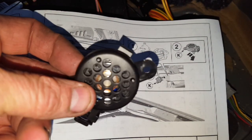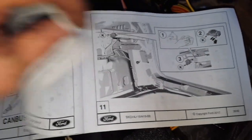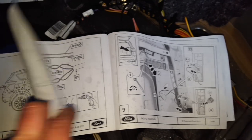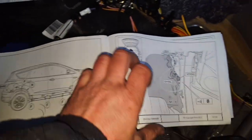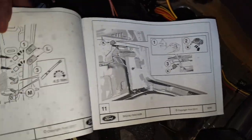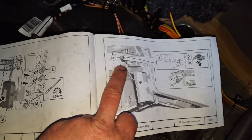Next we've been told to mount this speaker sounder. I have chosen to skip the canbus sections at the moment, mainly because it's raining and I'm currently working in the boot. All we've come up to so far is how to thread the canbus wires and which loom to cut into — we've done that section. We're now going to fit the speaker and come to the canbus wires in a minute when I can get the doors open and it's not pouring down with rain.